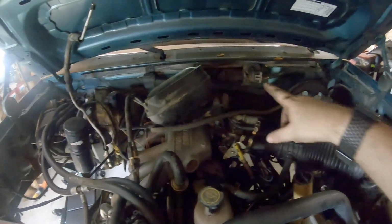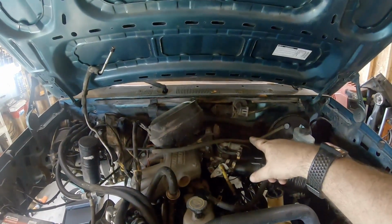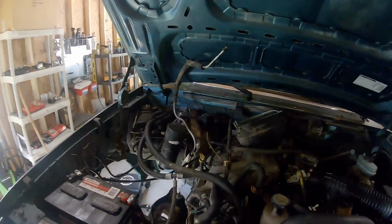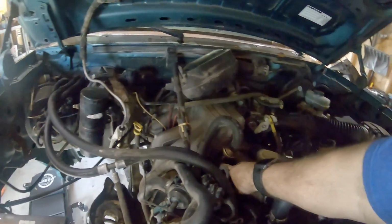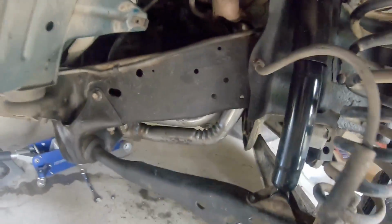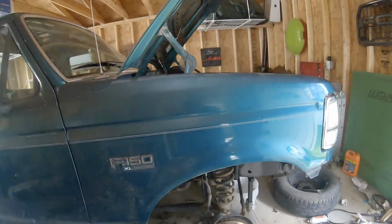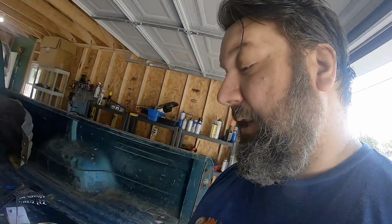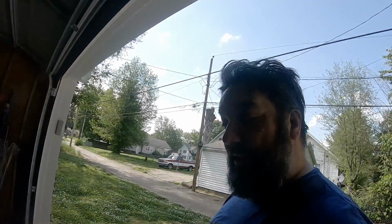So then I did order a black block off plate for the EGR itself back there. Then I gotta figure out how I'm gonna, if I remove all this stuff, I'll need to find a plug for this and then one for the exhaust down here where that comes in. So I'll have to find plugs for those, but that'll be a different day, different story. But yeah, so making progress. I would go try to find a connector piece. I'll cut this a little bit, put the new connector in there and put this in, and then call it good for now.